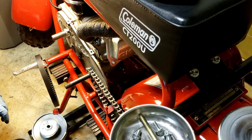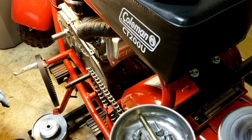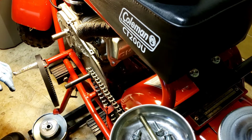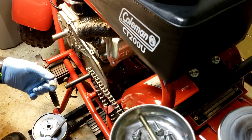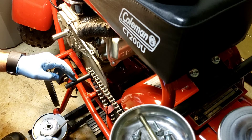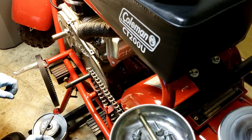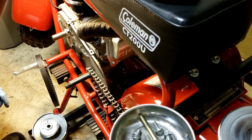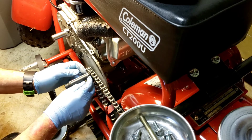You just want to take the slack out. You could cut up an aluminum can and make an aluminum can washer. That's what I've got in behind there to take up the extra side play — it also gives me another 50 to 80 thousandths clearance of the chain off the backing plate. The sprocket adjustment gives you in-and-out alignment, and you adjust the adjusters to line it up with the chain. If you just slide the 5/8 washer on, it'll come up against the machine shoulder of the jackshaft, so you need to hog it out a little to get it up onto the shoulder and take up that slack.